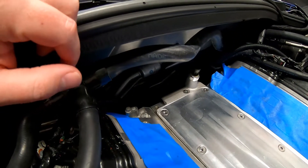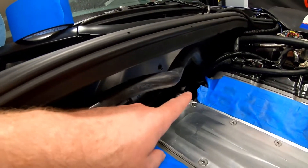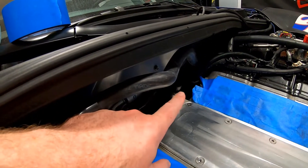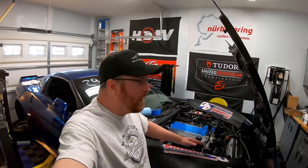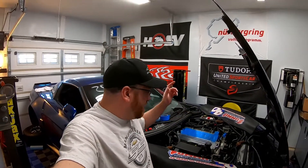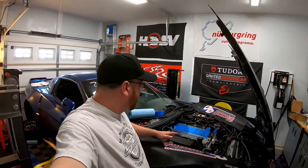The rear steam ports are on the back of the cylinder heads, and that block-out plate is on both the passenger and the driver's rear side. You can kind of see the bolt sticking out where the tape is. What happens is when you start to make a lot of horsepower with these LS motors, some of the problems end up being cylinders number seven or cylinder number eight. That's because there is uneven heat distribution going throughout the head, and that's due to the fact that they blocked off the rear ports. I don't know why they blocked off the ports.